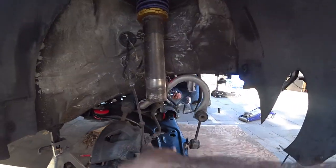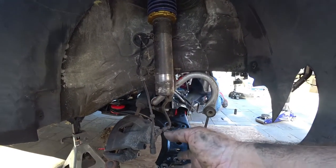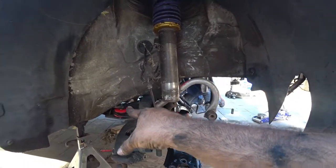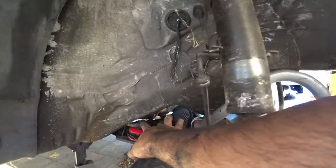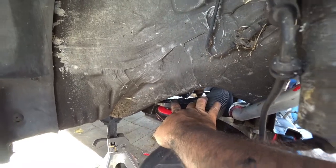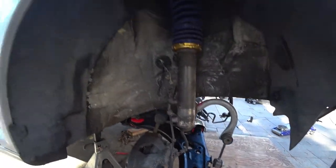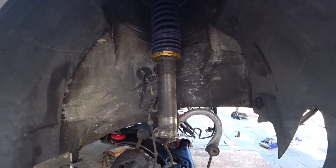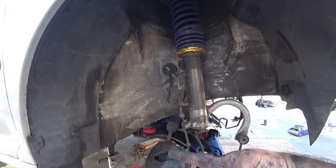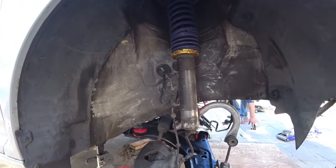So control arms are super easy. They come out the same way they removed them through the subframe. They use two 18 millimeter bolts. On top of that, the rear control arm uses a little nut on top right here. Make sure you have a wrench to get that all torqued down. But what we're going to do first is that we're going to torque down the subframe bolts. You always want to do those first. Then the steering rack. Then with the sway bar. Then, actually no, control arms, then the sway bar.